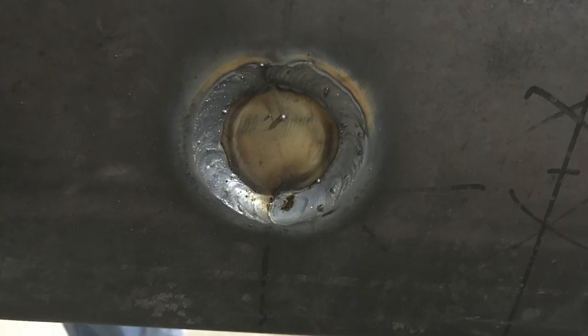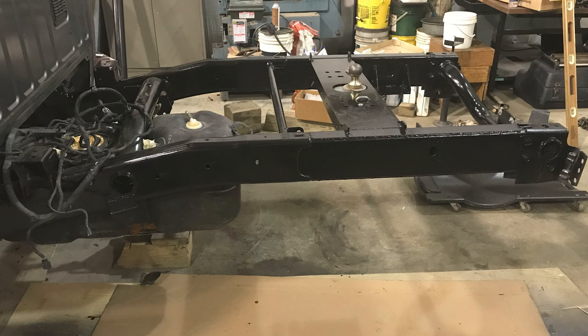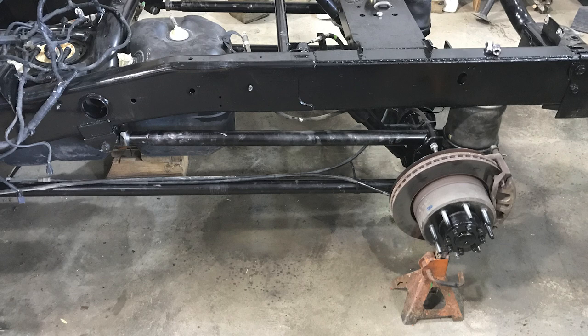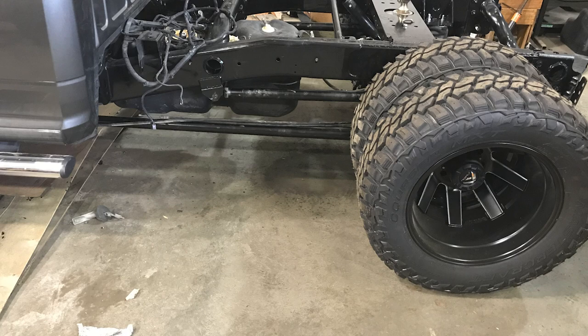Here's where that tucked in to the front part of the frame. This frame is very modular — it goes in different places. Here's a rosette weld between where the crossmember sits and where the bag mounts are, just to give a little extra strength there. Here it is all painted after we got everything welded up, with that bar running across the front for the upper shock mounts. Here it is with all the parts assembled — had it together three or four times — with tires and wheels on it and a hitch on the back.